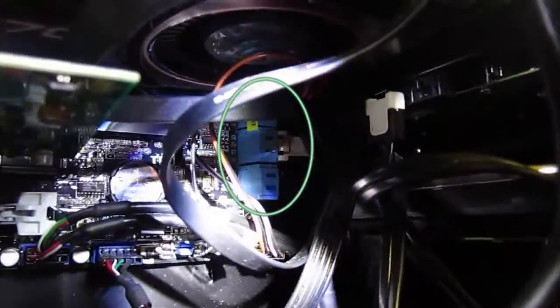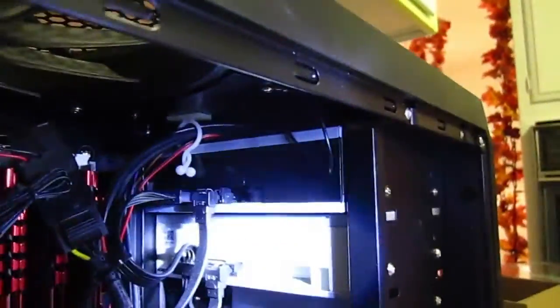So now I've gotten a different brand — Seagate Barracuda — to see if that works better. This motherboard can connect 8 SATA devices, but 6 of them are SATA 2 and 2 are SATA 3. It looks like only the SATA 2 ports are eligible for RAID, so I've been connecting everything to SATA 2. But I'll have 5 hard drives now and 2 optical drives, so I'm going to have to bump something to SATA 3. And oh, that's such a mess of wires.